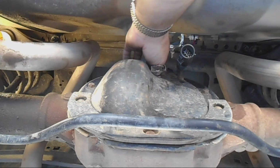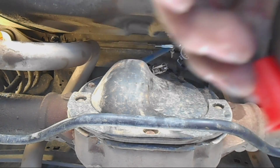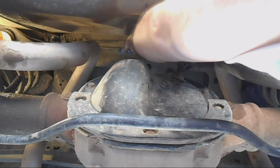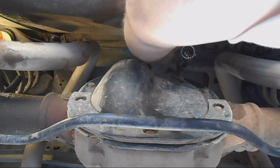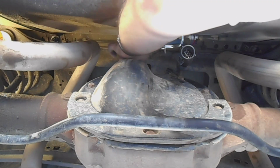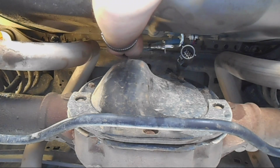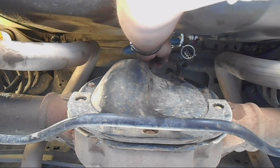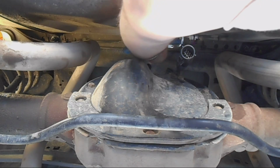So start with plugging in the fuel line. Take off the little red thing. I hope you can see this. Then you take the fuel line, slide it onto the new pipe till it clicks, and it's on. And then I'm going to zip tie it later. I don't know if you caught that. I put this fuel line onto that pipe. You heard it click. Then there's a clip here which you want to clip in that helps keep the thing together, not sliding. At least that's technically what it's supposed to do. Don't know if it really does much, honestly.